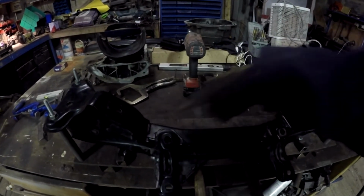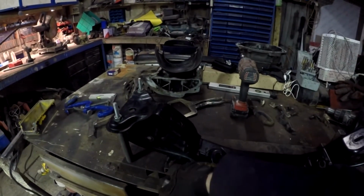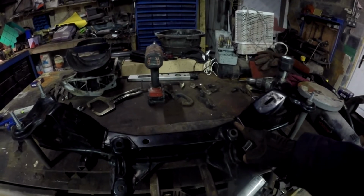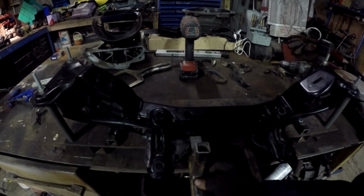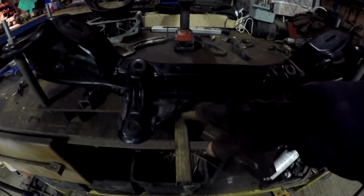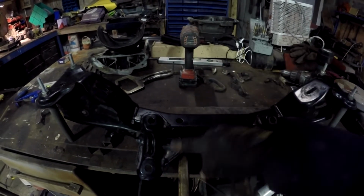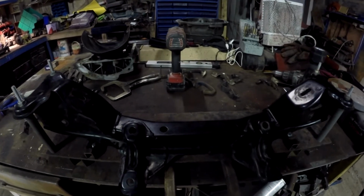I'm going to be cutting out the centre section there and there completely out of it. I have the end pieces bolted in and welded here in this location. So that means that those will not move. They're going to stay the same even when the centre comes out of it. When the centre comes out, I've got these things here where I have it marked. That's 42mm back, and that's the standard location. And once it pushes forward and hits that there, that's moving forward 42mm. So that's going to keep the steering rack in the same height, perfect, but moving it forward 42mm.